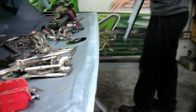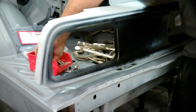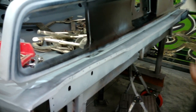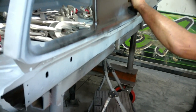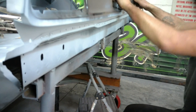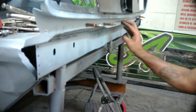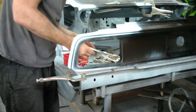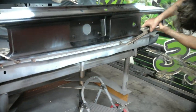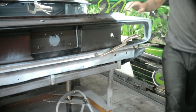All these are pre-drilled 3/16 with the punch. The tail panel goes inside of the trunk floor so it sits right in there. I got four holes that I pre-aligned — I centered it as best I could based on the gas tank and the trunk latch. The idea behind doing the tail panel and the other center pieces first is it gives us a reference to locate our two quarter panels since there's nothing on the back of the car. We'll work from the center outward. Don't get too crazy clamping this — you're going to have to move them.